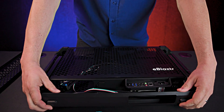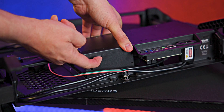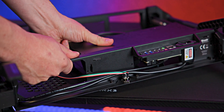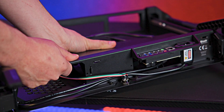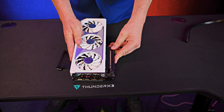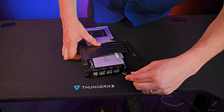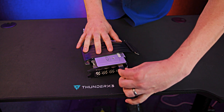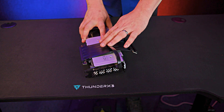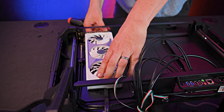With the top and bottom panels removed, you can remove the main panel by just lifting it off. Then remove the cable panel — this part isn't well documented, but simply push aside four metal tabs and pull the panel out. Next, install your GPU, connecting the riser cable as well as the provided DisplayPort cable, wrapping it around the back of the graphics card. Connect the power cables beforehand before connecting to the power supply. If you have a larger card you may have to remove another part of the chassis. Remember, the maximum GPU length is 330 millimeters and 70 millimeters deep.